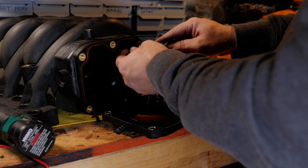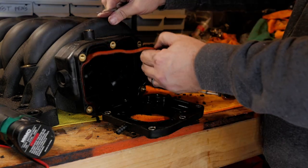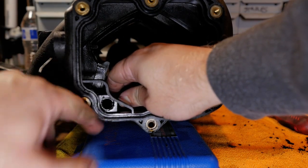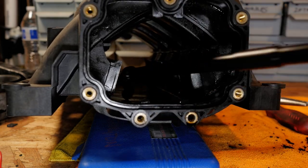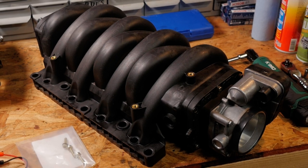We're also going to replace the gasket on this end — it's pretty much the same as the other one but a slightly different shape, so if you order a kit, make sure you use the right one here. There's also an internal tube and plate that run from the throttle body back to the crankcase vent valve that need to come out, so there's enough room inside the intake to wipe all that oil down. I've done a fair bit of cleaning the last few days and the intake is clean.